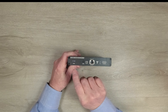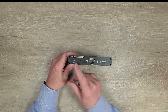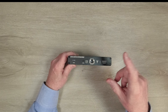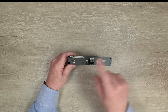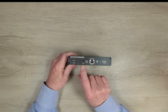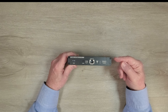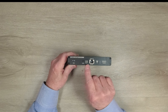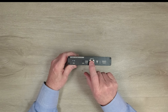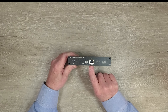On the other end you'll find two LEDs on the left-hand side. These indicate that you have a keyboard and mouse plugged in at the remote site — once you make the LAN connection between the two modules and connect the keyboard and mouse at the remote site, these will light up letting you know you have a solid connection. To the right of that is a reset button; hold it in for a couple of seconds and the unit will reboot. To the right of that is the LAN port — the single connection between the transmitter and receiver — which must be a CAT6, CAT6A, or CAT7 cable.